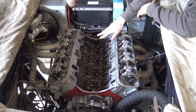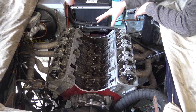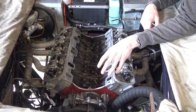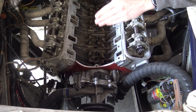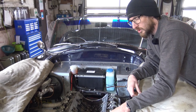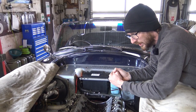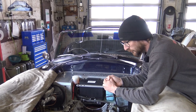So once all surfaces are clean, a little bit of brake clutch cleaner to degrease them. We have removed the distributor in this engine for ease of access. When doing that, we're making sure we're on TDC firing stroke, which means the rotor arm is pointing at roughly number one on the distributor cap - number one plug lead on the distributor cap. That just means when installing it back in, we know exactly where we are for ignition timing.